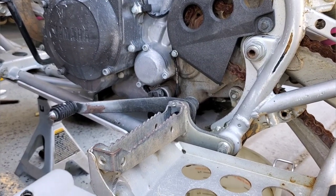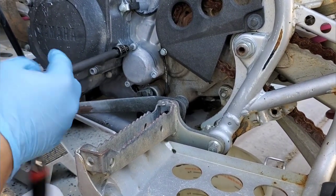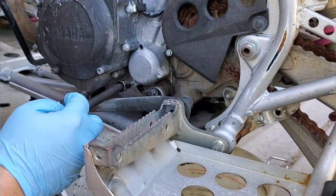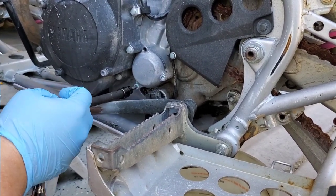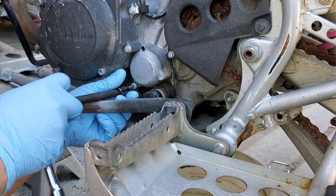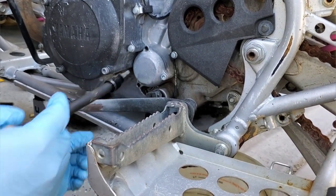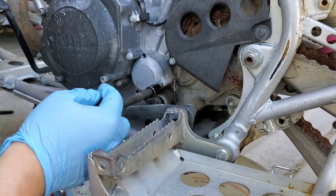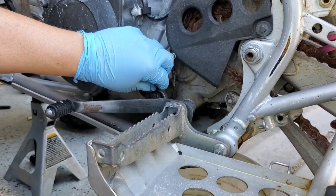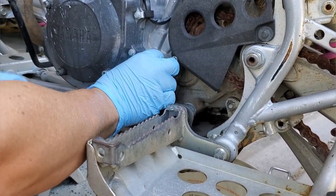The filter screen was amazing. Now we do the oil filter — these are 5mm allen bolts. We take them out, take out the cover, and inside the filter housing there's just a little bit of black material and clutch debris that ran out of the filter. It's really not bad.